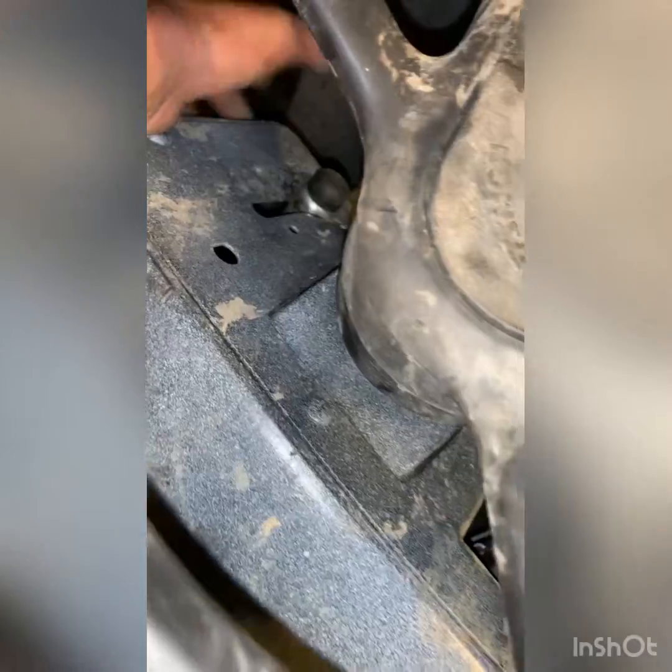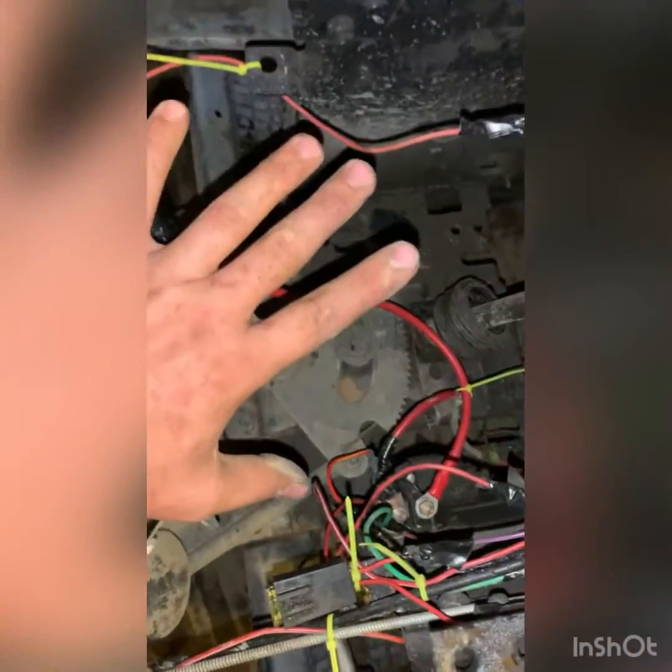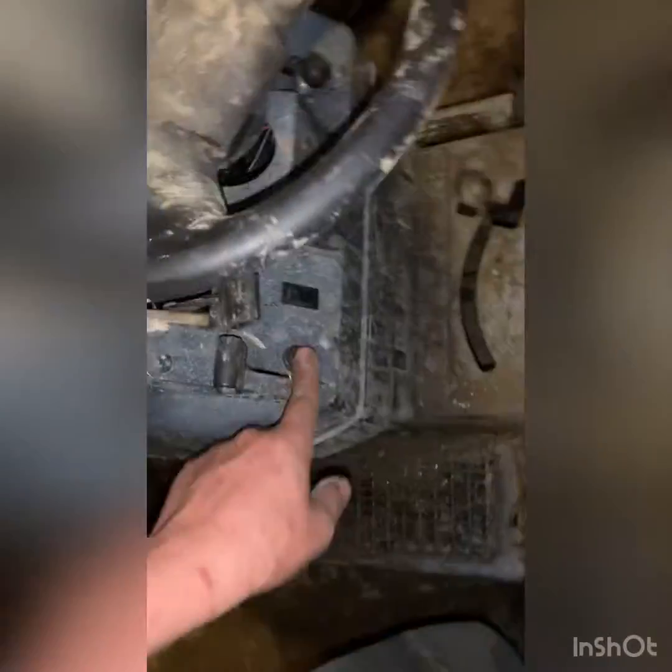Got a solenoid in here, and over here I've got a push start now. I was just jump starting before, but I've just done the wiring. I can't set it up right now because it's late at night and everyone's sleeping. This is my wiring — got a fuse wire and everything. I have a video on my YouTube channel of how to wire this; I did it on that mower. The original switch came out of that but it's in the original spot at least.